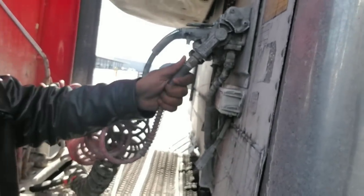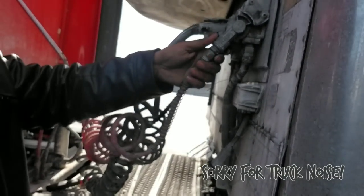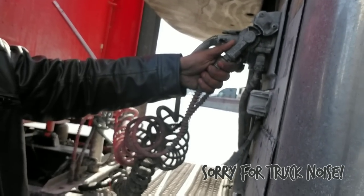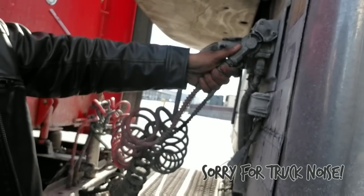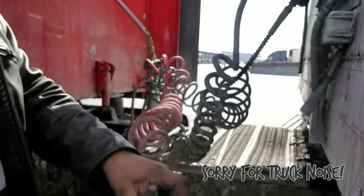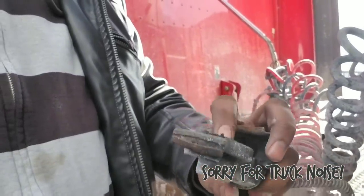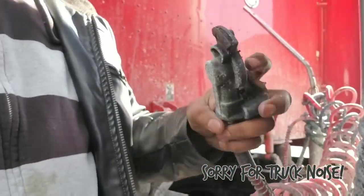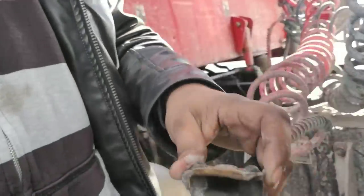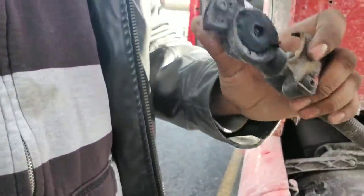If you look at them — my air is released inside. But if you check it out, you gotta be careful because you might have pressure there. Check it out very slowly. As you can see, there's no air coming onto this airline. I have my right airline released but there's no air coming to this line, which typically should come here. So there is a 100% chance that there's some problem with the air tanks or the airline.